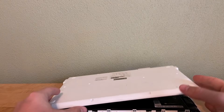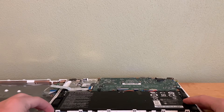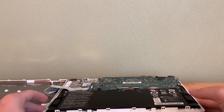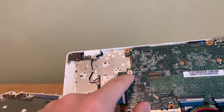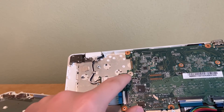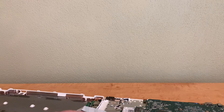The first thing we have to do is remove the developer screw so we can put the Chromebook in developer mode. You'll need to take out all the screws on the back and pop off the back. This is the Acer Chromebook 11 CB3-111. The developer screw is in different places on different Chromebooks — on mine it's right here. It should be a totally different size than the other screws.